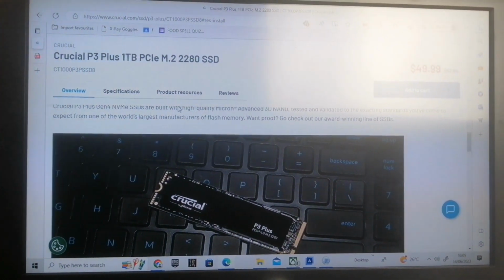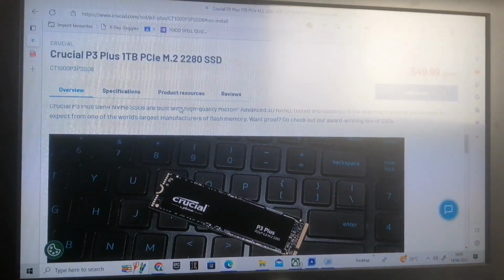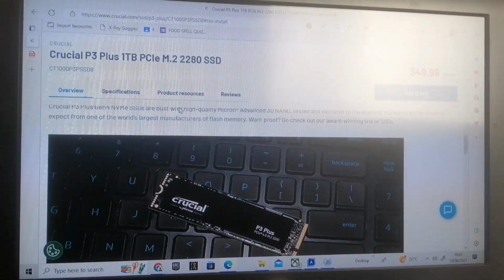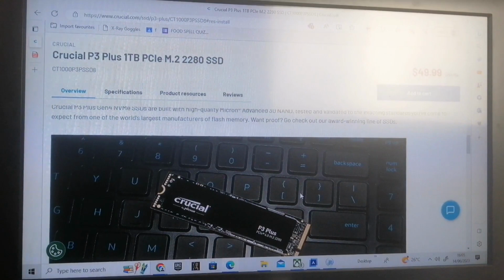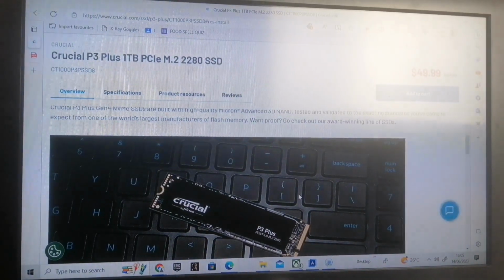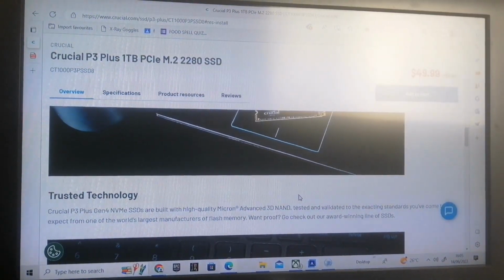So now basically I'm going to move away from my SSD drive and use my NVMe drive. Because of that, I want to use the system and Windows from the faster drive. So I'm going to have to clone my SSD drive and transfer that to my new drive. When I put my NVMe drive in, I spent a while trying to figure out why the computer was not recognizing it. So I came to the conclusion that I should download the driver.